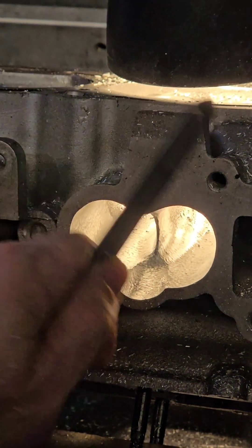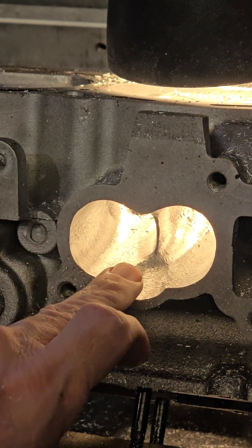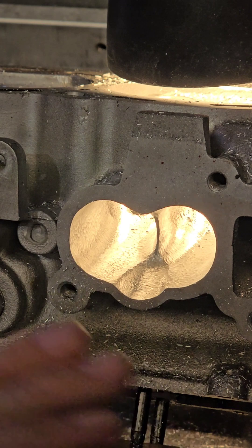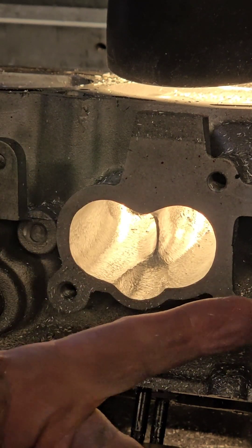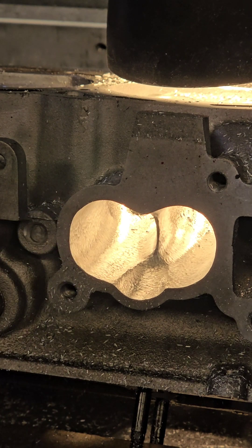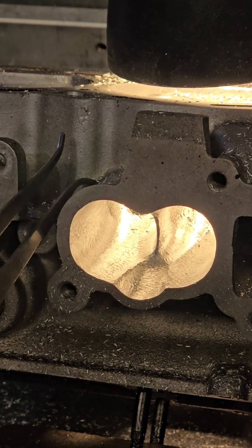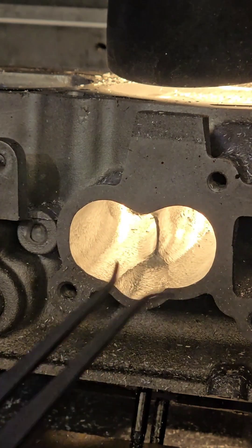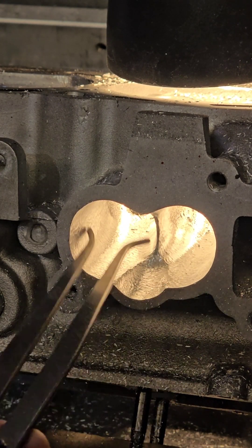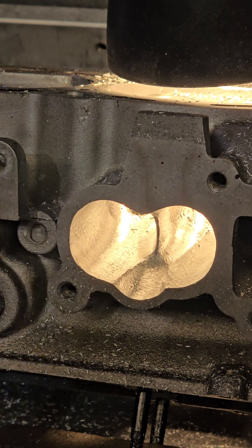If this wall's slightly bent and that wall's slightly straight, if the CSA is right the airspeed is going to be right. Small changes aren't going to bother us as long as we don't have sharp edges and steps. This is why a hand ported OEM cylinder head, especially in the twin cam market, should always be able to beat a CNC head in peak numbers, in boost threshold — meaning where they start to boost. Hand ported generally always boosts earlier than a CNC head and in average numbers throughout the horsepower curve. That wall is nearly 60 thou that way compared to this wall, yet the cross-sectional area is almost bang on now.